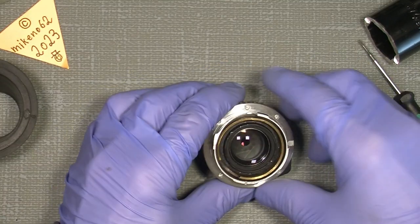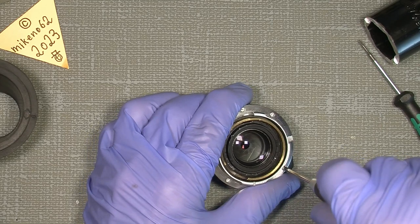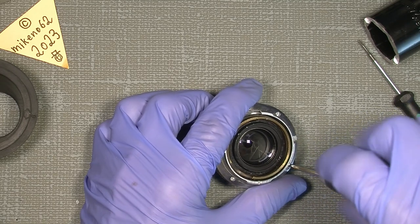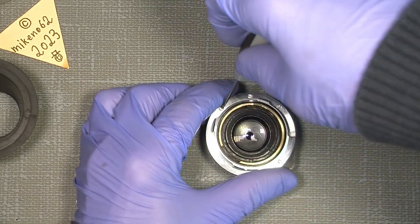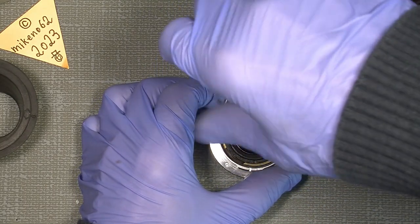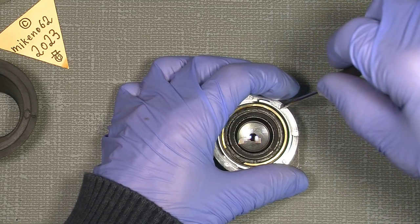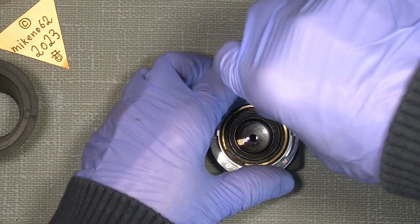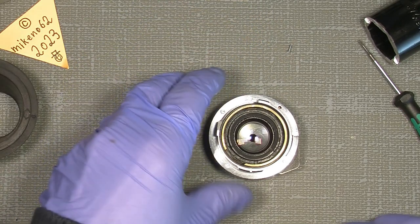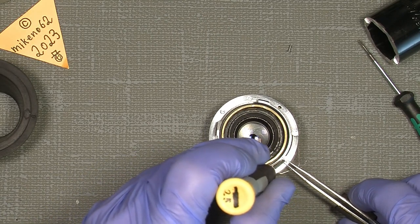But first, the five screws here on the back were not really that hard — some of them, but use a good screwdriver, straight flat head. I will use thread lock on those screws when I put them back in again. The screws are magnetic and all the same size and length, so there shouldn't be any problem.